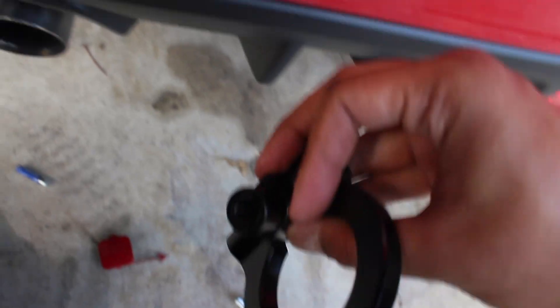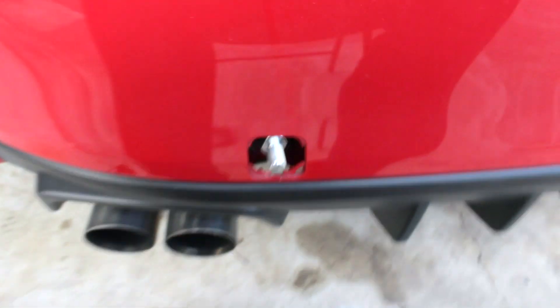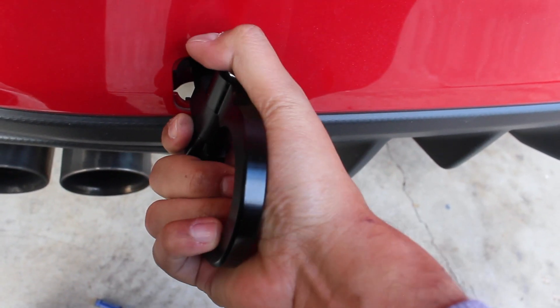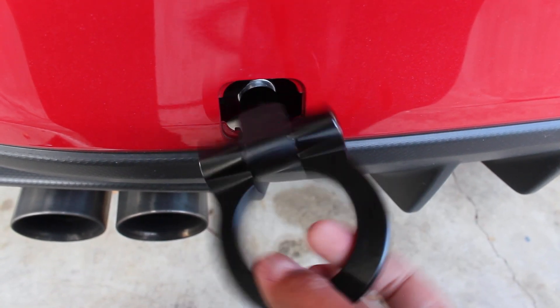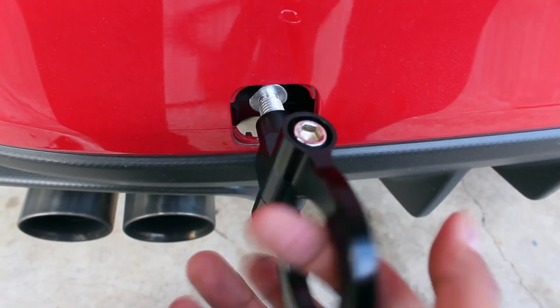From here it's pretty simple. The smaller part of the rod goes in first, and the thicker part goes right in there. Getting it screwed in — it's pretty tight, seems to actually be in pretty far. It looks like it will go down all the way with the depth, so I wasn't sure why I needed that extra little screw at first. But you need it so you can align this correctly, because with it on the bottom it's loose. By adjusting that piece you can pull it in or out of the thread to make sure it lines up correctly. That's in there real good.